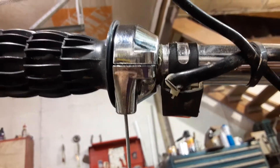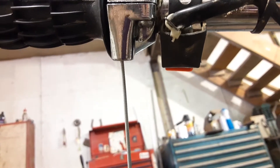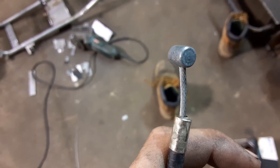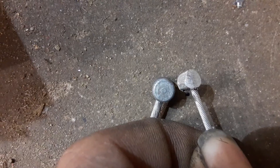All you got to do is take this end of the brake cable and come over to the bench grinder. What you want to do is grind this down and get it to match the size of the throttle cable stop. That'll allow you to put it in the twist grip.